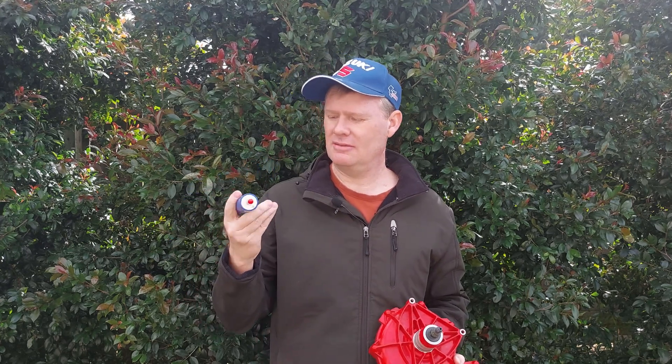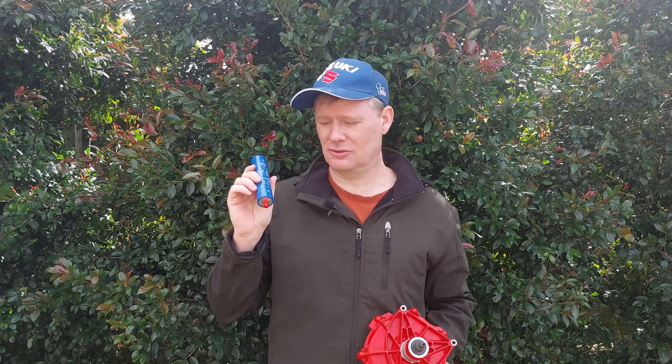The batteries I'll be using — all the cells will be these here. I doubt you'll have seen these before because these are very new to the market. These are LTOs, and I'm going to do a whole separate video on why these cells. These are 2.4 volt, 6 amp-hour LTOs. I'm going to run 18 of those for the supercharger.